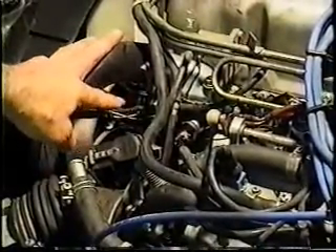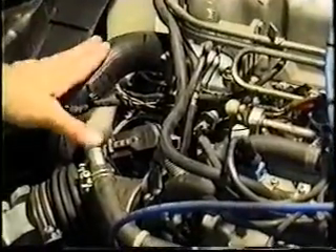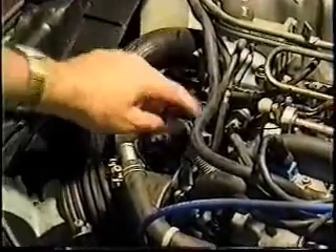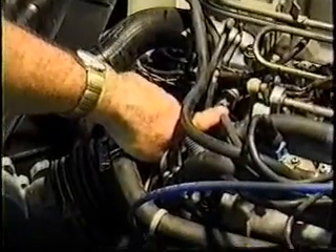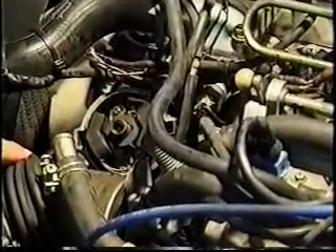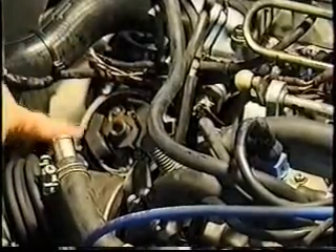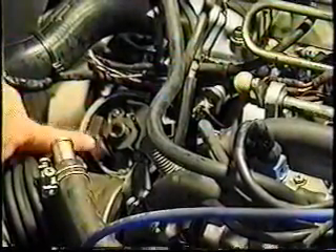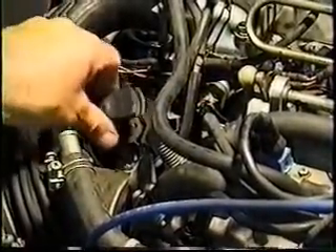These are hard to get to. If you go to disconnect them, take your time and get the clips off underneath. Both the distributor advanced and retarded coils respond to this sensor — on any of you who have two pickups in your distributor, one is advanced and phased some six degrees earlier for a cold start. It starts on the advanced side, and then after it warms up, switches back over to the retarded side.